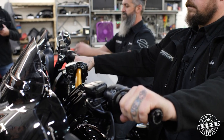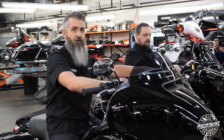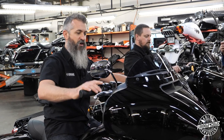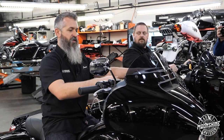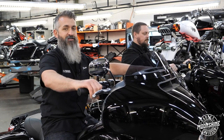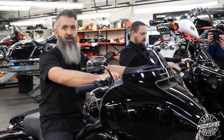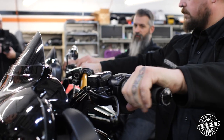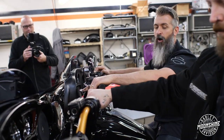On the other setup you can still see the radio because the bars have the kickback, but you are reaching over it a little more. So keep that in mind when picking your setup. If you're not hitting the controls a lot and you're comfortable maneuvering through your controls from the handlebars, that setup works. If you want a little more visibility, this is the better setup for you. This one has adjustability — hands going numb, loosen a couple bolts, reposition it, torque them back down and you have a new feel. With the fly moto bars, you can just rotate them back or forward, but there's no swing in and out for your hands. They're both great setups.